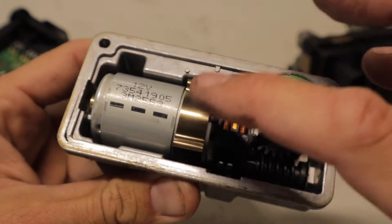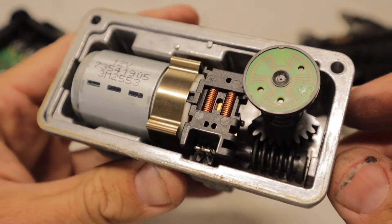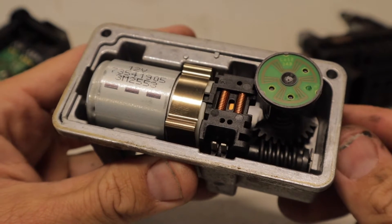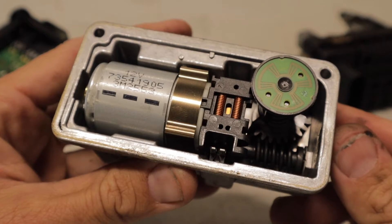When you have to buy a new one, it's not the actual motors that fail — it's these plastic worm gears inside that fail. That causes these to basically just get stuck in an up or down position, come up with a fault code on your dash, and put your car into limp mode.